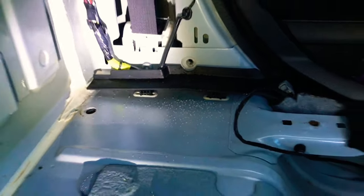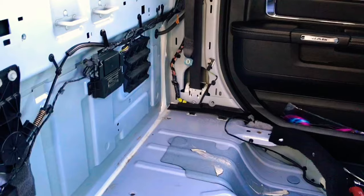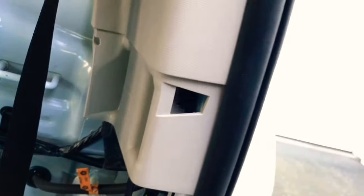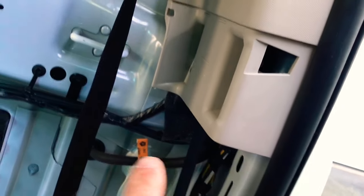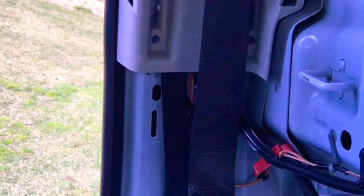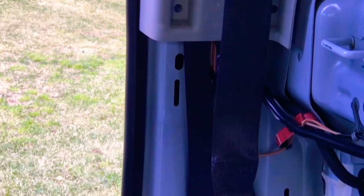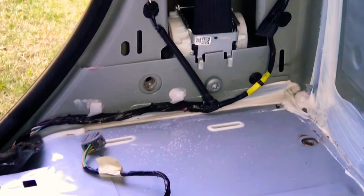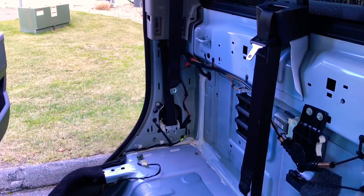So it's the third brake light. I like to test everything first because it could be all three things — could be the window, could be the vents — but in this case it's just the third brake light. I squirted it again and that's definitely the leak. It's funny how it's coming from here though, you'd think it would come from somewhere else. The other side is leaking too, so it's definitely the third brake light. I'm kind of relieved — it's leaking like a sieve. Let's go look at the third brake light.